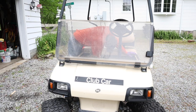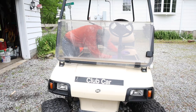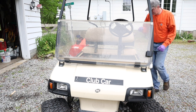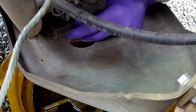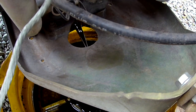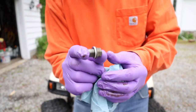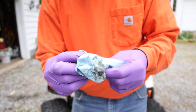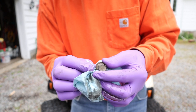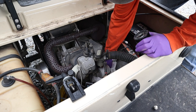Found one — cracked it loose. Loosening it right up, getting ready to drain without dropping the plug. I can feel there's a small gasket on the plug — we don't want to lose that. The oil drain plug has what appears to be an aluminum washer on it for a good seal — 14 millimeter head, nice big threads. The oil filter is going to leak a little bit of oil, so I'm going to stuff an old cotton towel there to catch some of it.